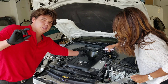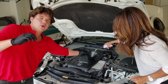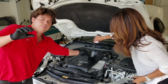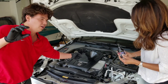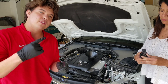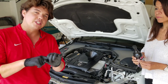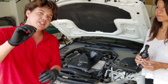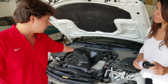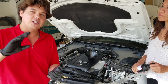What it does is it thins out the oil and gets a lot of the carbon deposits out of the crankcase. A lot of the turbo Mercedes have coolers, oil ports, and turbo screens, and those screens actually get clogged up and the oil doesn't flow through right. There's also turbo coking where oil burns inside the turbo and acts as an insulator, not allowing the oil to cool the turbo. This will exponentially protect the turbo and bearings, clean all the junk out of the crankcase, and get you better compression.